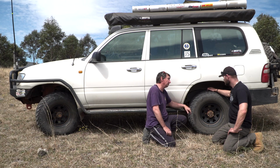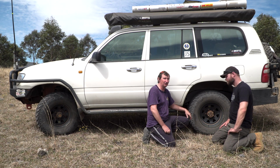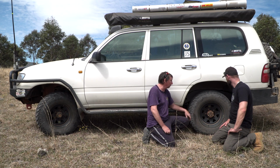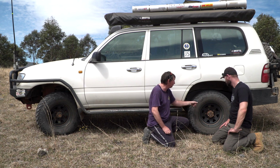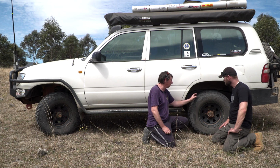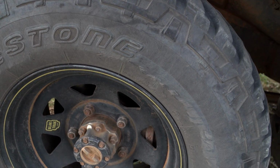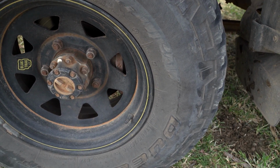The other one, I was with you. We did that one in Ningaloo. Unfortunately, we couldn't save that tyre because we ran on it for a few Ks before we realised it was flat, and we chewed out the inner sidewall. But no, absolutely fantastic tyres. The only fault I can probably pick with them, and it's not brand specific, it probably covers a lot of brands, is that the tread blocks do chip out on the real sharp gibber stones in WA. But you get that with all tyres. Overall, brilliant tyres. Yeah, absolutely.